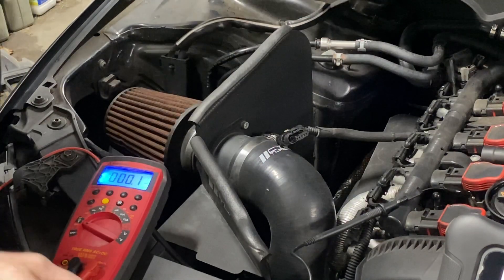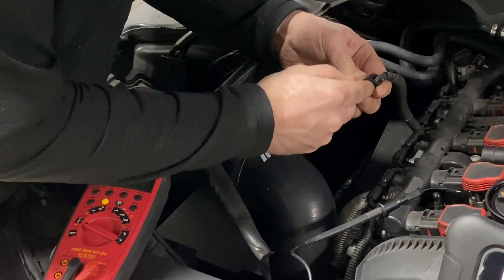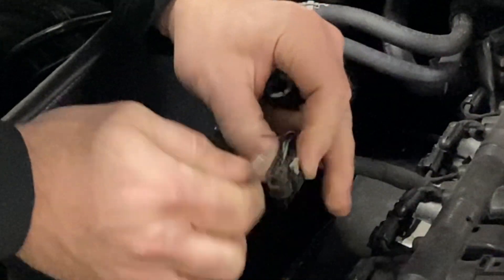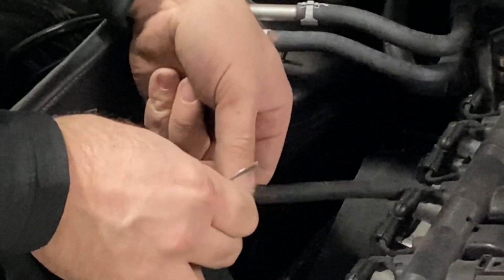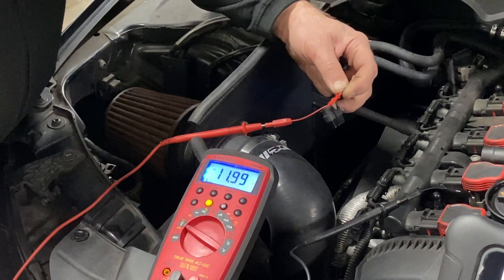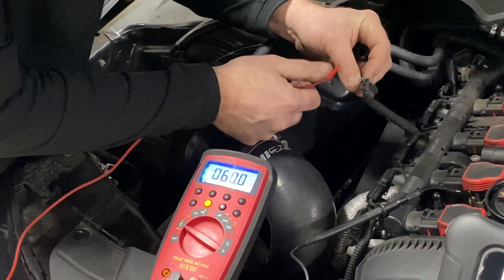I see something already. Is it going to really be that easy? I never get that lucky. How does this cover come off? I think the wire pulled. Let's see if we have 12 volts. There you go. Let me see if I can get a replacement plug for this because it's broke down inside. That or I've got to try to extract that pin and re-solder this.